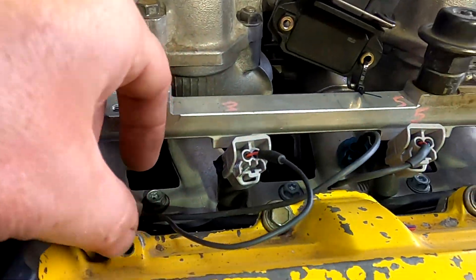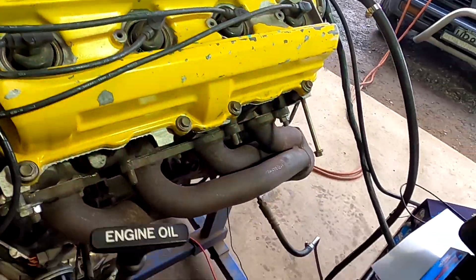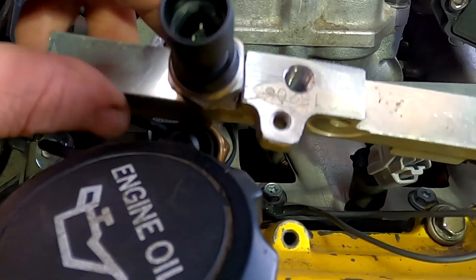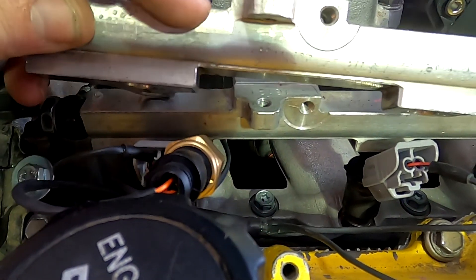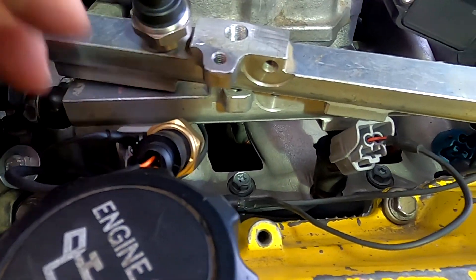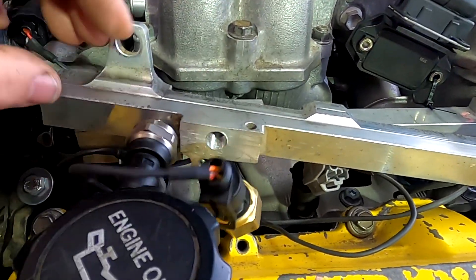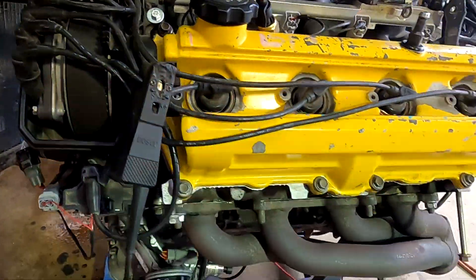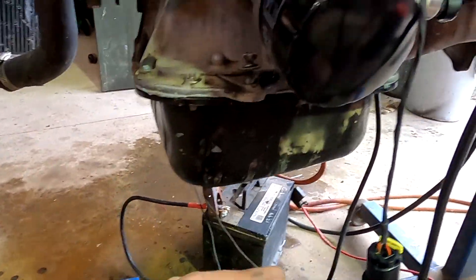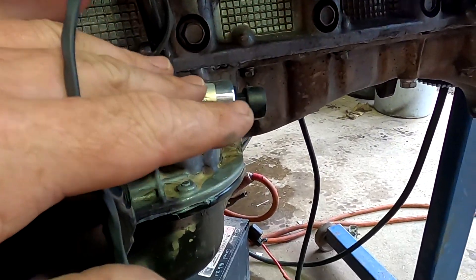On the Link versions that can be operated, there's an igniter to mount on the firewall. This one's got the fuel pressure sensor here — some of them can go on the other side. Jason did a little bit of exploratory drilling and tested whether there was enough meat in the fuel rail. We're actually probably going to move that one over a little bit if we do another one, which allows us to use the same rail and pop the sensor in at the front. I like fuel pressure — the plug is in the loom standard, but we don't supply the sensor, that's a bit of an upgrade. And then for oil pressure, this particular one just gets oil pressure light.